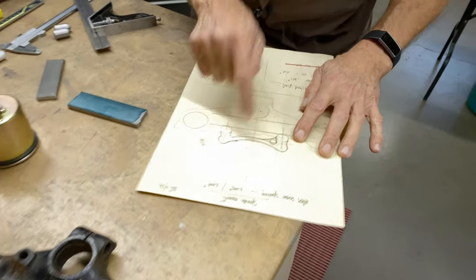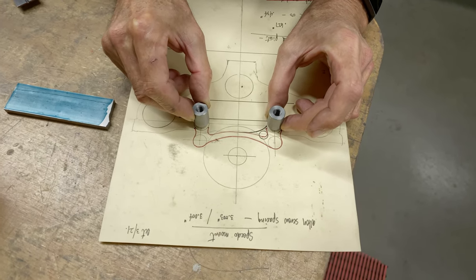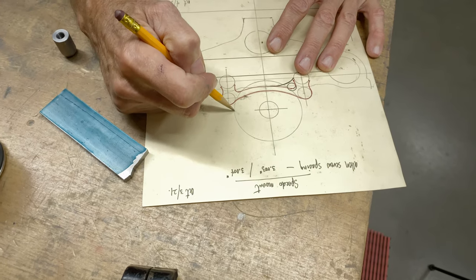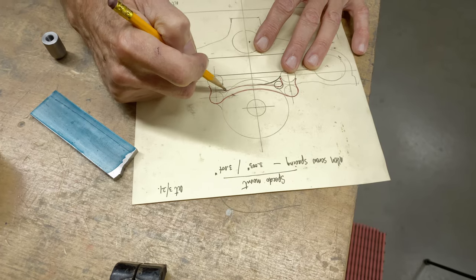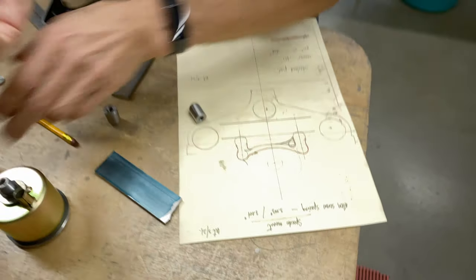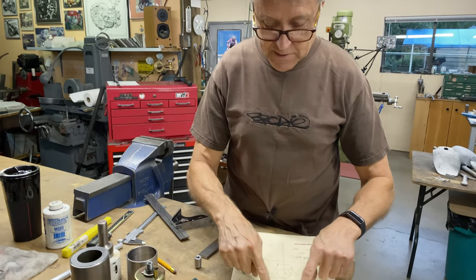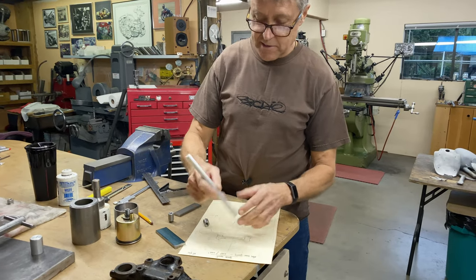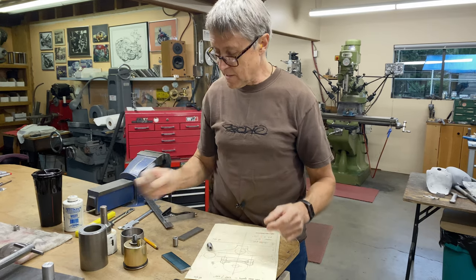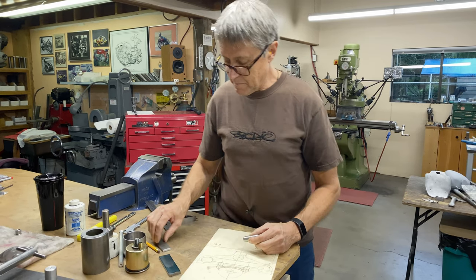See this shape in red — that's how it's going to be. This is the quarter-inch plate, and we're going to have some additional plates coming off here. I've got a hole saw that's a close match — a little smaller. Those mounts get silver soldered on. There will be risers made out of half-inch aluminum rod, about three-quarters of an inch long, with an Allen screw going in each side. That's how the speedo is going to get mounted after a lot of tossing and turning.